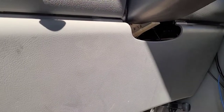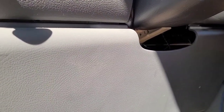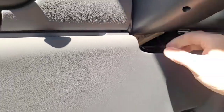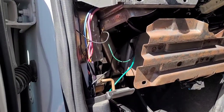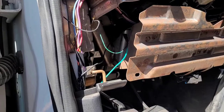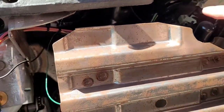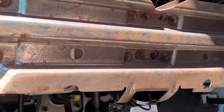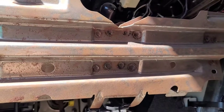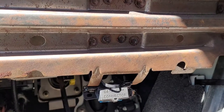Okay, we got the wire over here. Grab a hold of this panel under the steering column and give it a yank — that comes right off. Now we're going to take this out of the way. It's got six 8-millimeter bolts.